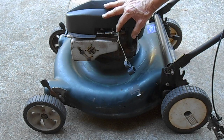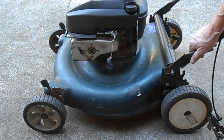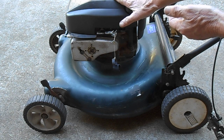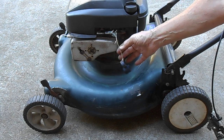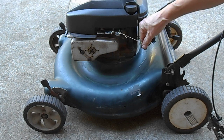So that's how it works. Pull this and it's going to engage up here and shut it off. This allows you to mow and go pick up a limb, move a rock, or pick up a toy without having to come back and crank the mower again with the pull cord. You can just come back and the mower will be running until you shut it off by using this kill switch.